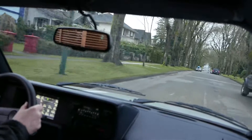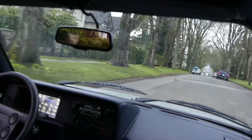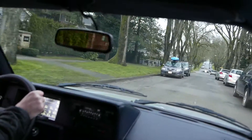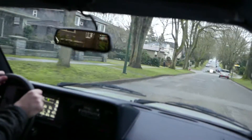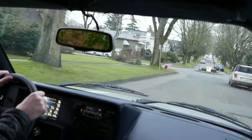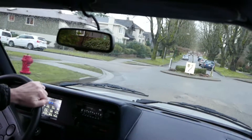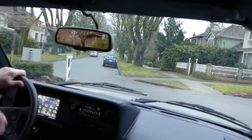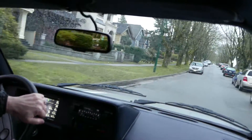Applying the brakes — the bigger pistons definitely grab firmer for a given amount of brake pressure. The car stops with authority. I definitely have a bit more pedal travel. It's not a huge amount more, but I would say I'd probably have to push the pedal almost an inch further. I may need to bleed them one more time.